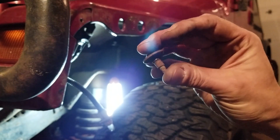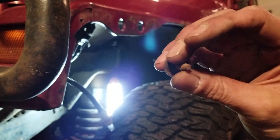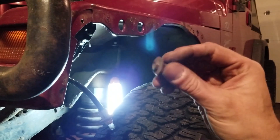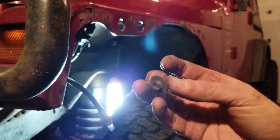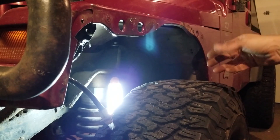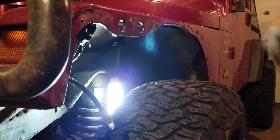On the last couple of bolts, instead of those plastic backing nuts, it's got these inserts — these plugs that are stuck in the sheet metal. In my case the bolt is seized right to it, and these things just spun in the sheet metal, so I just pulled them out. But it's off — ta-da! You don't need to save your old ones. Mine are all cracked and faded — nobody wants those. Just cut them; makes it way faster.